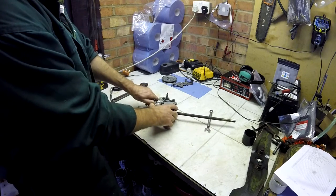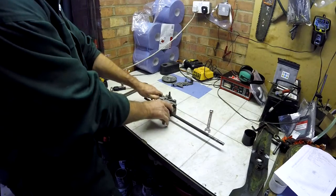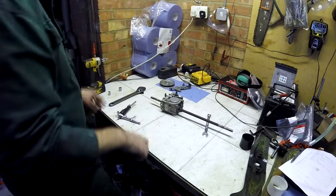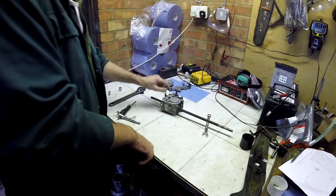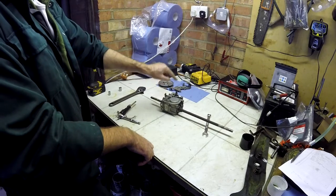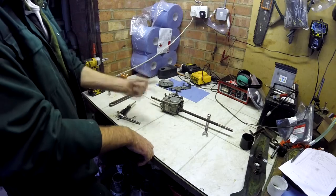And the speed can be controlled by this lever here, which goes to the cable we took off earlier. So the input shaft also has a seal on here, but the shaft is upright and is also hidden from the weather with a pulley. So generally, this doesn't do much work, and they normally last a long time. So I'm not going to change this one, because even if it fails, the oil and the gravity is going that way, not up that way.